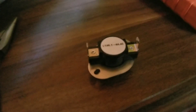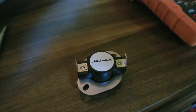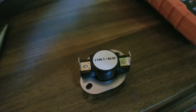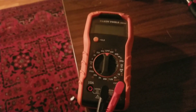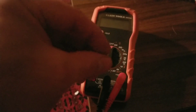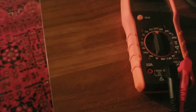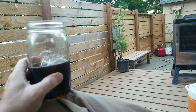So that's what it does — it's basically a high temperature limit switch, and it's to protect your dryer from burning up. You can also take a limit switch thermostat that doesn't have continuity, smack it several times against a table or the floor, and it'll often renew the continuity. You can check with the multimeter once you're done.